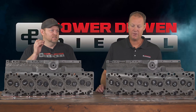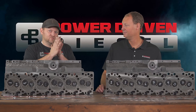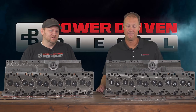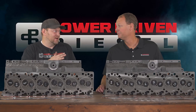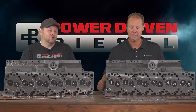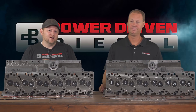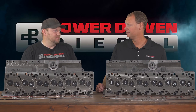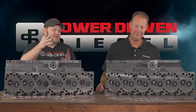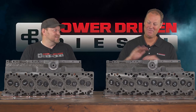If you try to do a fire ring with factory head bolts it's not going to crush properly. There are a couple shops in the southeast that do it, but they CNC machine the block and head perfectly flat and true. Most guys' heads and blocks are not perfectly flat and true, so you need good head studs. Even the cheap ARPs are questionable. I would say Torque Master, ARP 625, or the Opti-Torque are really what you should have. If you have 14-millimeter hardware, that's fine, but if you're in 12-millimeter hardware you really should upgrade. I've run fire rings with cheap ARPs over-torqued and they're right on the verge of breaking — right at the yield point — and that's not correct.